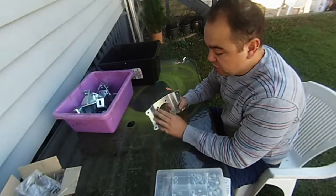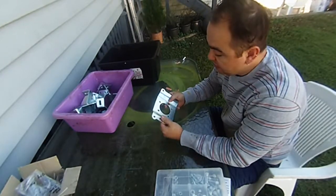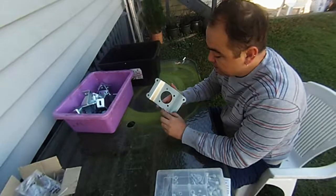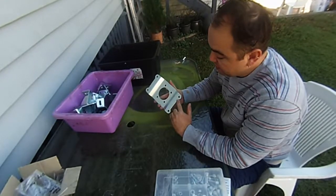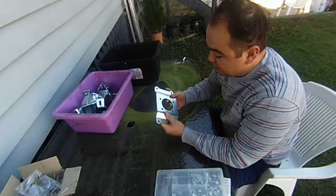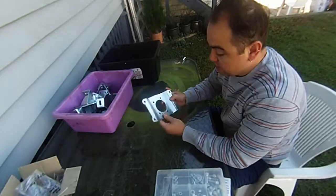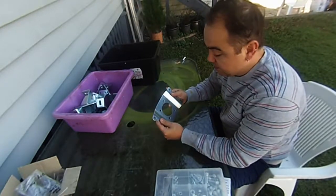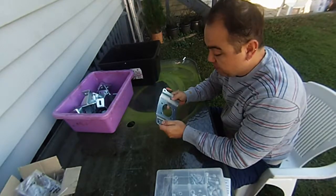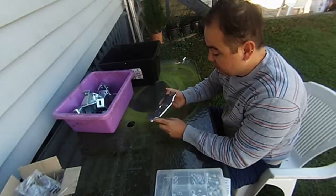These are my new dual EL caliper setup for R31s. So you can run either twin R31 calipers or twin VS calipers and an EL Falcon rear rotor on an R31. I'll hopefully put one on this weekend, test fit it, so I can make a post and start selling them. But I think they come up alright. They're a bit different to all the other ones.